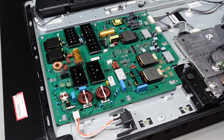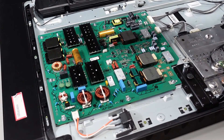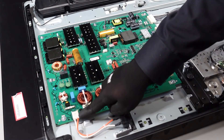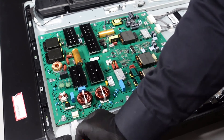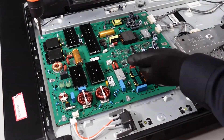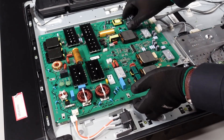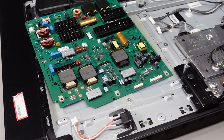We've saved the easiest board for last — the power supply. We've got one, two, three plugs and a handful of screws around the outside and that'll be it. Pinch it down and pull it out; pinch it down to release that latch and pull it straight out. Our power cord connects right through here — press down the middle lever and pull it on out. Then we've just got a handful of screws. Take another look to make sure nothing else is connected — looks like we are set to go. Be very gentle in case there's adhesive — and there we go, folks. We have this television completed.